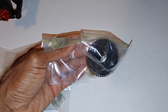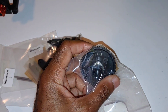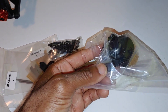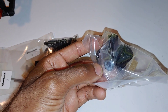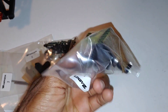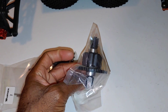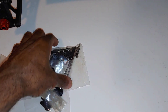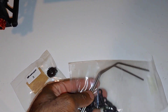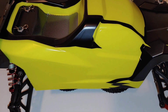They include two completely assembled center diffs — there's one inside the truck and then there's this other one. This one says 49 teeth, so this is a 49-tooth spur. I believe when they did this, they started running the truck on 6S — if you run 6S they want you to put this in with a smaller pinion gear. It looks like about 10 to 12 teeth. If I was to run on 6S, I would put this in, but I'm probably just going to run this on 4S.